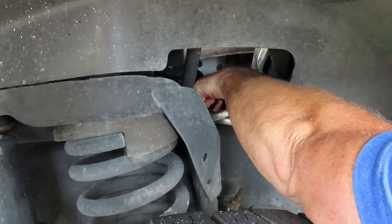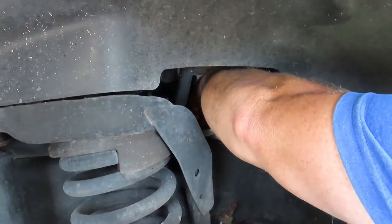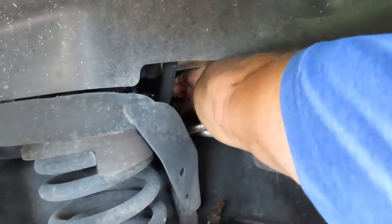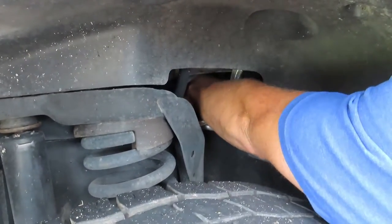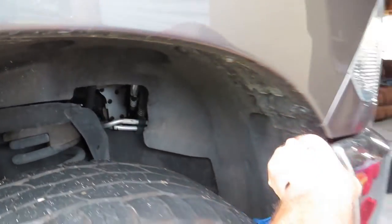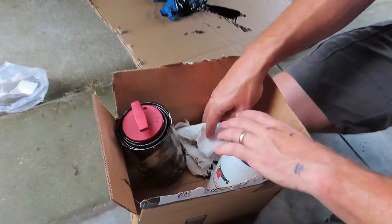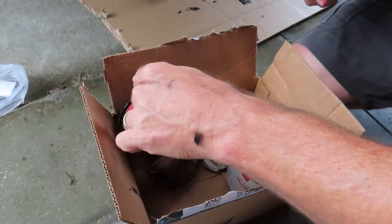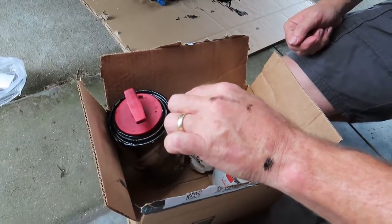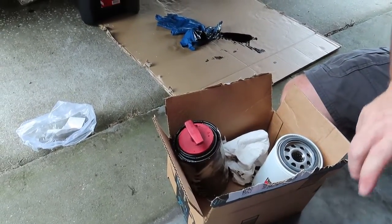Take your little red plug and screw it into the top of your filter because you can't get that filter out straight — you have to turn the filter sideways and pull it out through that hole. If you don't have this tool, you're going to spill oil all over everything, which is typically what happens when you take your truck in for an oil change — they don't have this tool. Just spin that little bad boy in there, make sure it's snug, lift it up, and bring it on out.